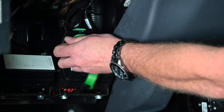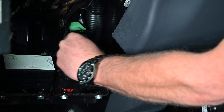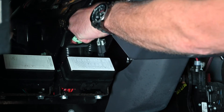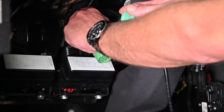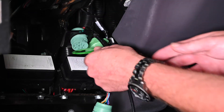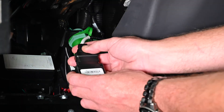Attach the fleet tracker onto the accessory harness required for the specific vehicle you are working on. Remove the vehicle's communication port and attach it to the accessory cable's male connector. Once everything is connected, mount the new cable head using the screw down mount or the flange collar to the dashboard of the vehicle.